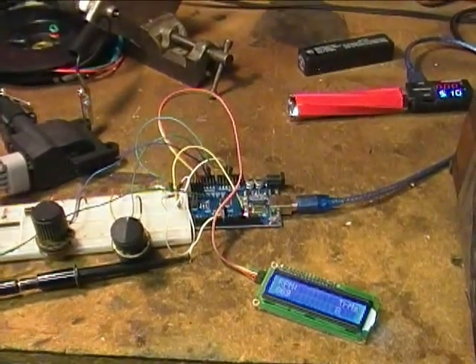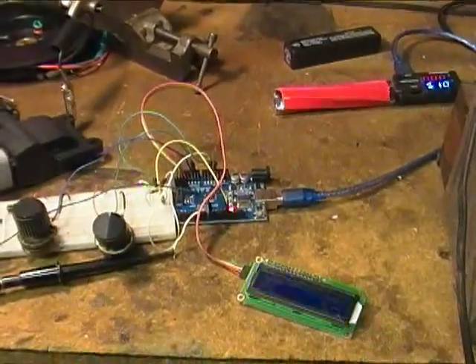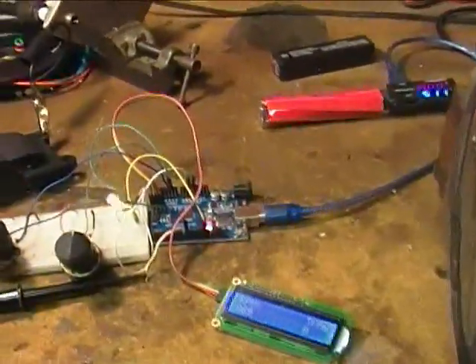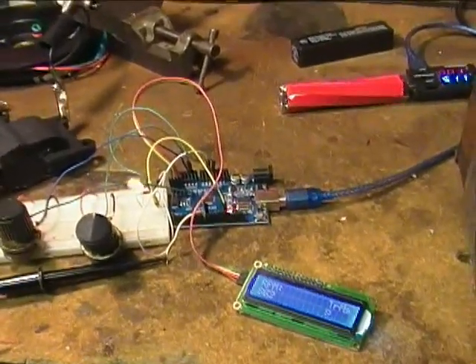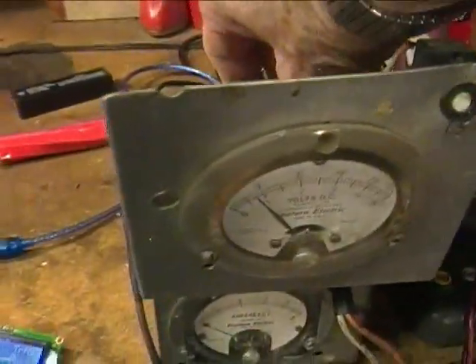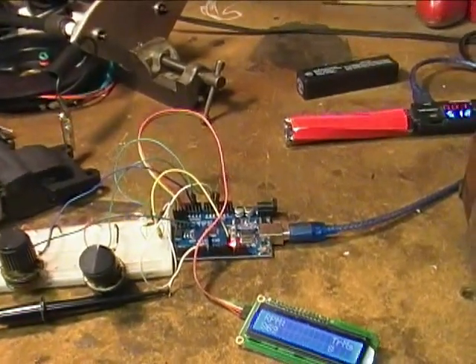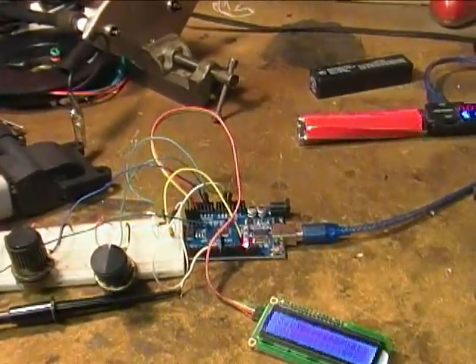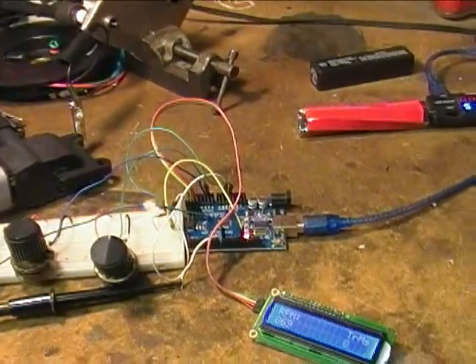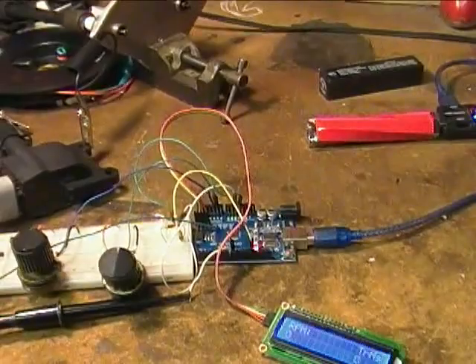You can see some of this flashing as the antenna action resets the UNO, and if I turn the spark power off you'll see that totally stops. Now we have no voltage and no problem. As soon as we turn the voltage up — so I obviously have to do better shielding and heavier ground wires.